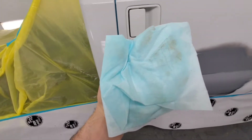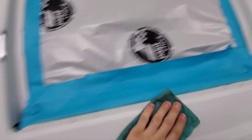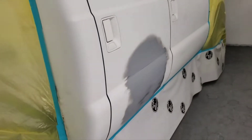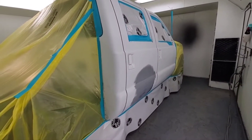Always use a clean rag — you can pull some dirt and dust off if you missed it. Up next, tack rag. Use light pressure and just gently wipe it down. Don't put too much pressure because the tackiness in this rag can be left behind on the panel. What this does is remove any loose lint or dust that's still on your panel or that could have landed on. Just making sure everything is clean — waterborne clean, degreased with the solvent, and tacked off.